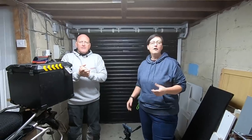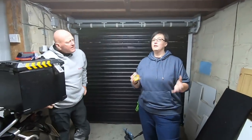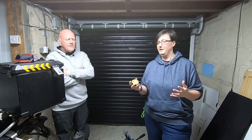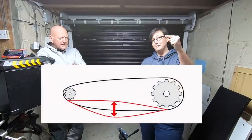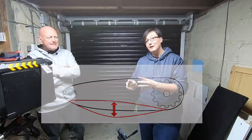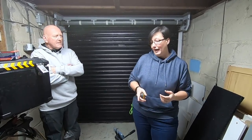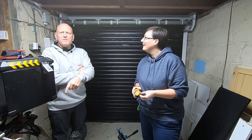There are a couple of different ways to do it if you haven't got special tools. You don't need to spend stupid money on a simple maintenance task — something as simple as a tape measure or ruler works. When looking at chain slack, you're measuring the difference between the top and bottom of the chain. Your manual will have specifications for that tolerance or allowance, usually measured in millimetres. Some bikes even have it printed on the swingarm, which makes life easy.